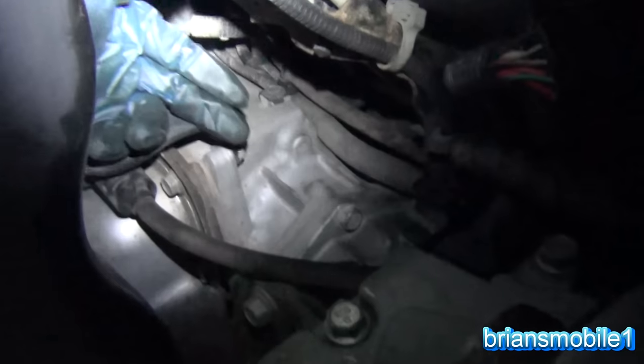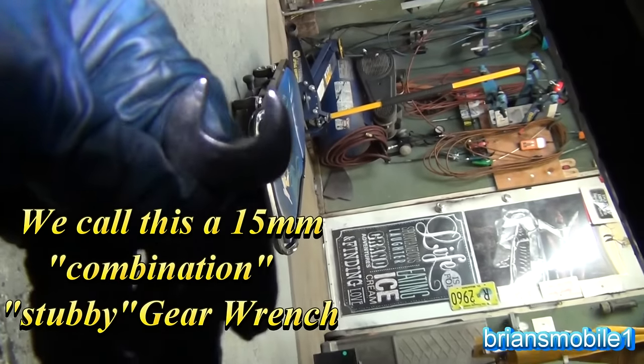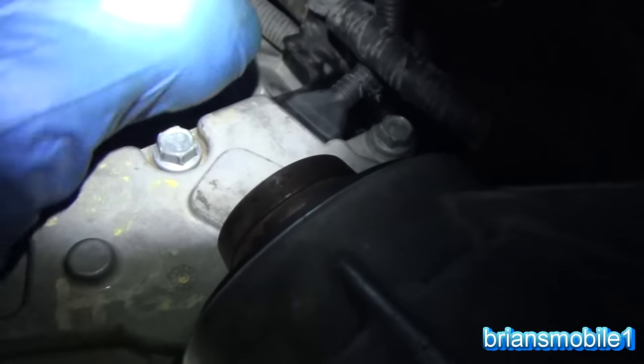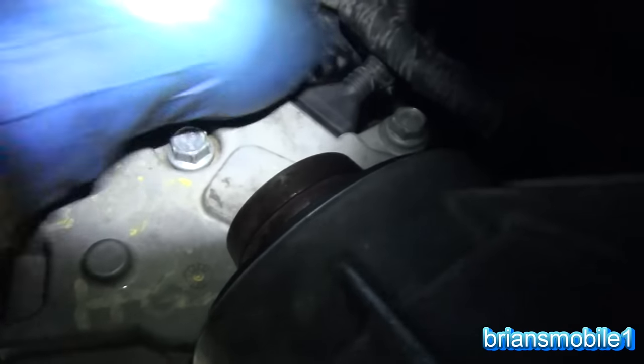It looks like a funky angle — it's hard to get an extension in there because everything's in the way. I strongly recommend — I'll put a link in the description — a gear wrench, just a little 15 millimeter. It's a combination wrench with a box-end gear wrench on one side and an open-end spanner on the other. Use the spanner on the hard-to-reach ones. On that top bolt it's especially nice because you can't move far — just wiggle it up and down and it pulls right through.